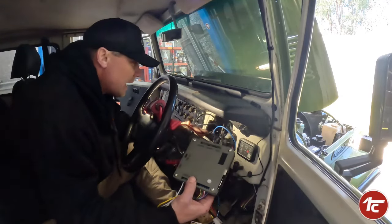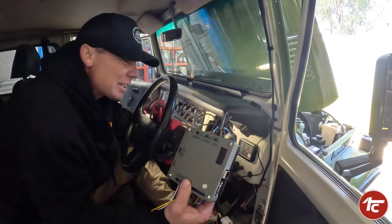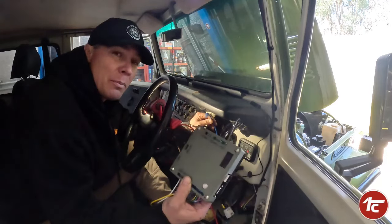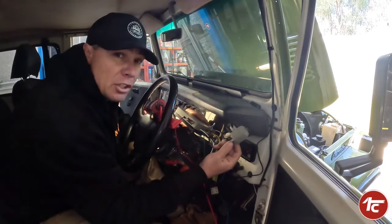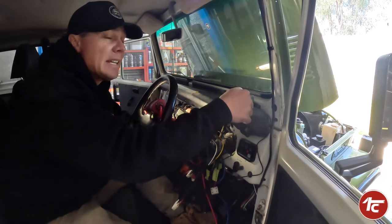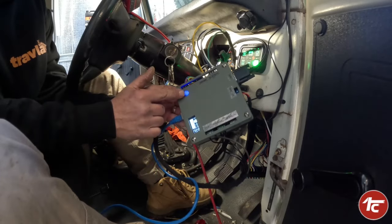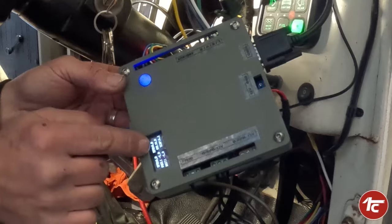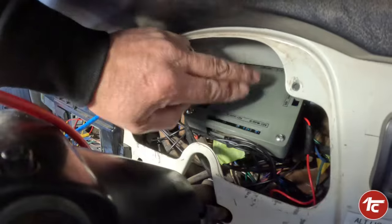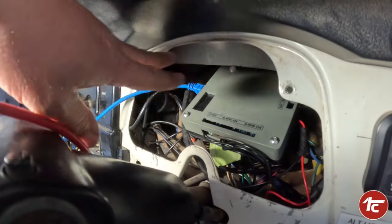It's time to put the brains unit into the 40. It looks like a mess of wiring but it's all actually quite neat. Now that we've made all our plugs it's plug and play. We've got our data cable which goes straight from the brains to the dash, and this is our GPS unit - we really should have the GPS unit tucked up somewhere it can see better. Before we put it all in we're just going to give it a power up to make sure everything's okay - power on light, speed, RPM, fuel, battery, temperature, oil. The brains unit sits in here with nothing protruding, so it's actually a perfect location for it.